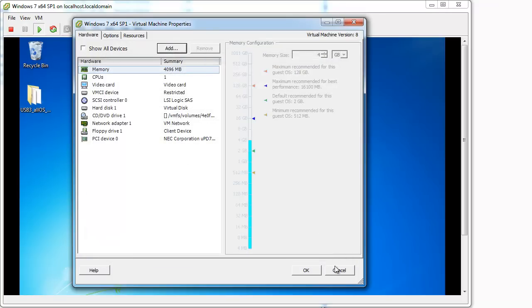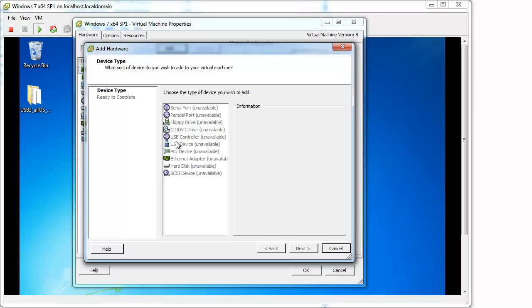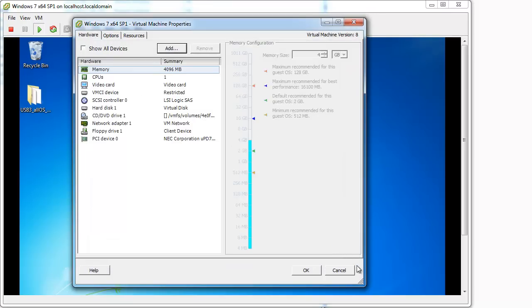Had it been a RAID controller, it'd be a little less confusing because you really wouldn't expect to be messing with those two. But because it was USB 3.0, at first I had some issues understanding that really all I wanted to do was pass through the PCI device, which makes sense in hindsight. So hopefully you found this video useful. Thank you for watching.